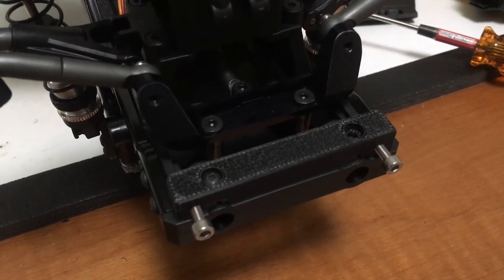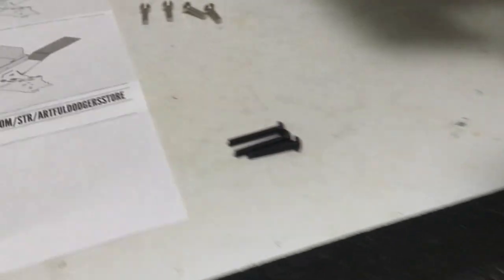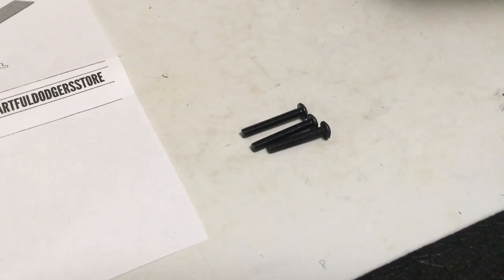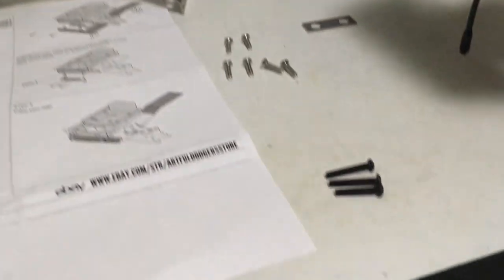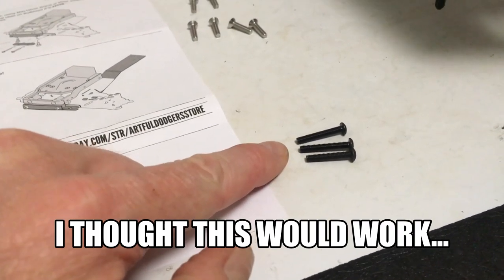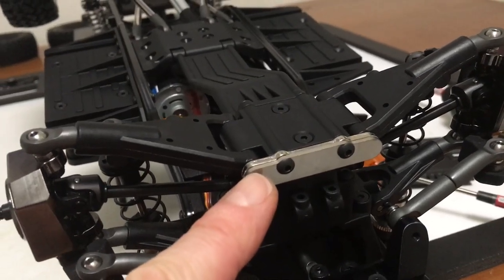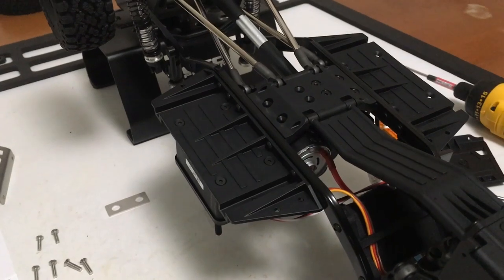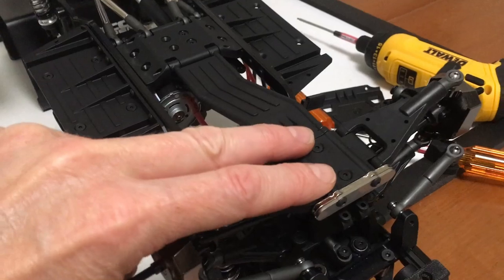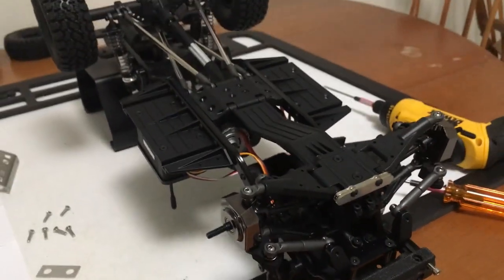First little issue: they ask you to reuse your stock hardware for this mounting block. You can see it's recessed, but there's still some thickness to this mounting block. So what I'm going to do is get some M3 20mm screws. The stock appears to be 18mm, so I'll use 20s — that ought to get me all the bite it originally had. And then this is the retainer plate you add since you're pulling off the stock plastic skid. The rest is basically adding this hardware, attaching here and here, and there's a little washer shim that rides right there. I'm going to move right ahead and try to get this on.